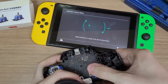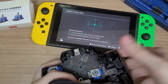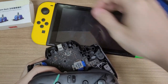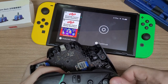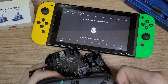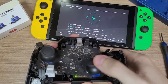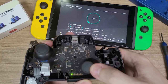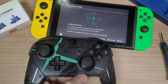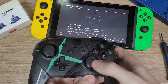Eventually, I managed to finish the calibration on the right stick. The calibration persisted even after a reboot, which didn't happen with the Joy-Con sticks. But the thing is, the analog sticks were calibrated without the shell — when you add the shell back, the range of the sticks gets limited, and you can't use a magnet to calibrate them with the shell on.